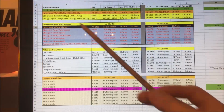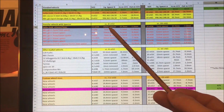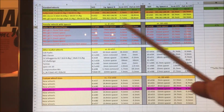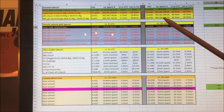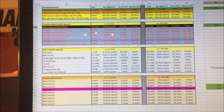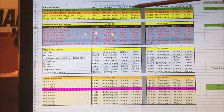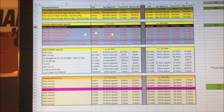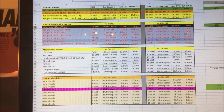But what makes really good sense is if you've got these early 7.5" wide wheels, a 15mm spacer on the front and a 7mm spacer on the rear brings both front and rear wheels set in 7.7mm equally from the GT3 outside faces of the wheel, and that's why it looks so well balanced, because it's exactly set in the same from those GT3 wheels. So yeah, I completely understand that logic. If you're starting out with these wheels, it seems to make perfect sense.